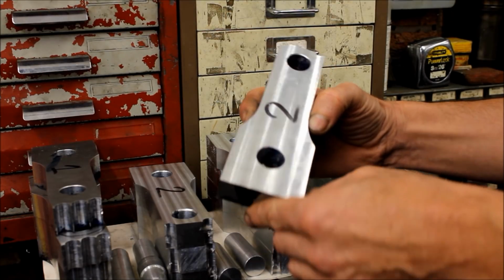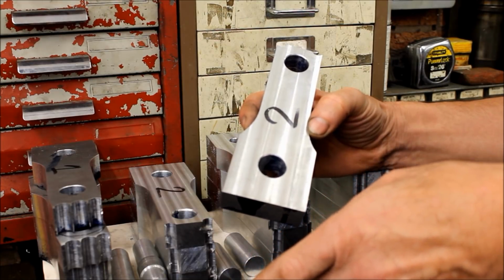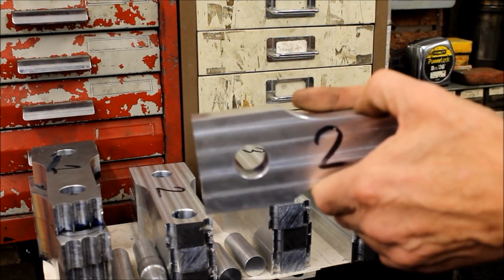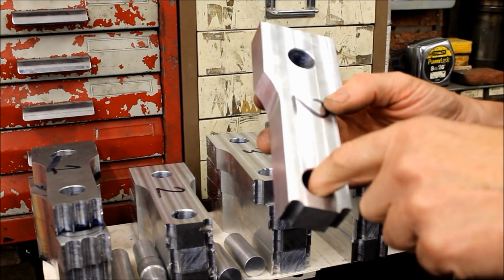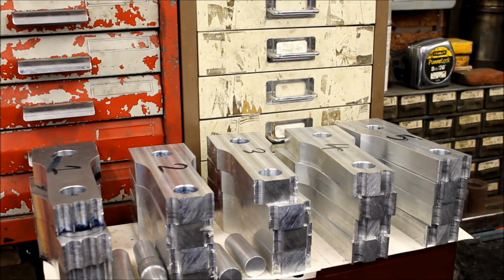Okay. So when's that going to happen next then? Is that going to be this week? Well, hopefully. I'm just doing these barrels, which we'll come to in a minute. So they're just waiting for time on the miller. And then obviously the bronze bush. They can have a bronze bush put in there, whatever size gudgeon pin you've got, within reason.